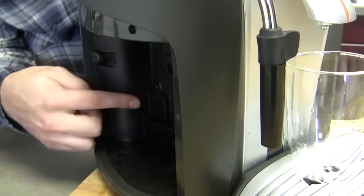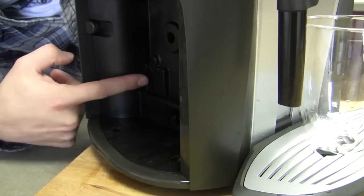There's actually a common thing that happens with these machines: if you're putting your water tank in full of water and you're still getting that alarm, your sensor board on the other side of this wall is no longer adhered to that wall. You need to send in your machine for service because a tech needs to get in there and get that board back adhered to the wall. It shouldn't happen with any of our refurbs because they make sure it's all adhered really well, but as it ages it might be an error you would see. So if your water tank is full and you're still getting that alarm, nine times out of ten that's going to be your issue.